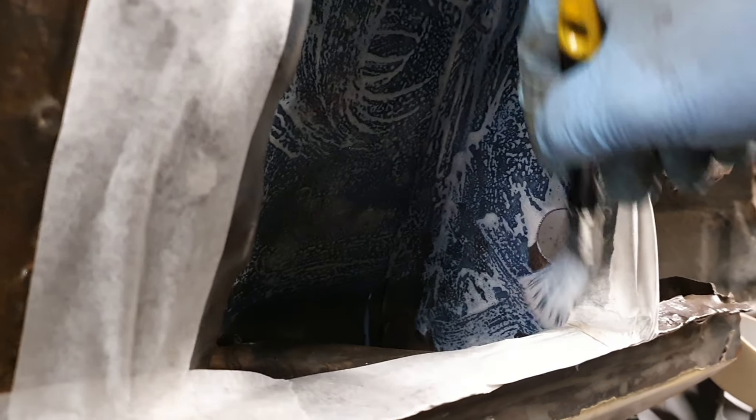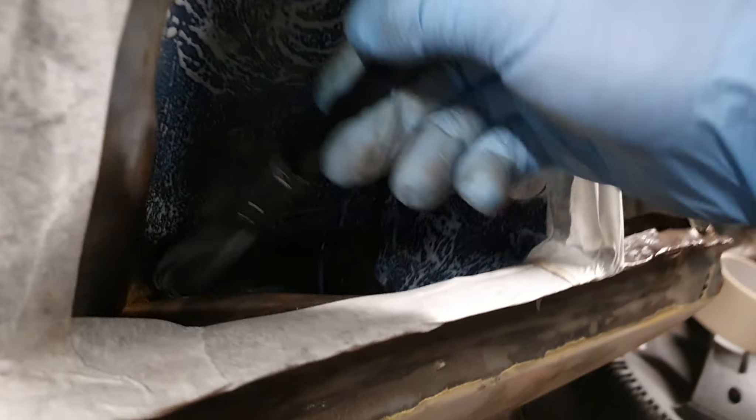Because it's all masked off you can just start painting the cure rust onto everything — all this rust in here that you want to protect — because Ford didn't do anything with it, they didn't care. Once this is in there and it sets, you can go over it with whatever you choose; you can just spray it directly with paint because you're going to seal it up anyway.